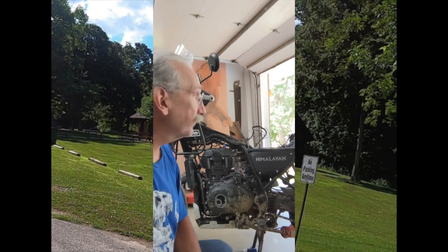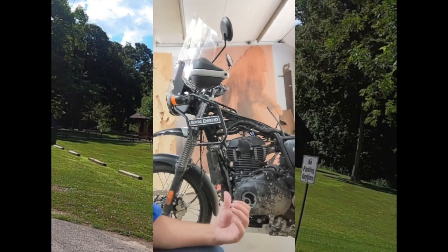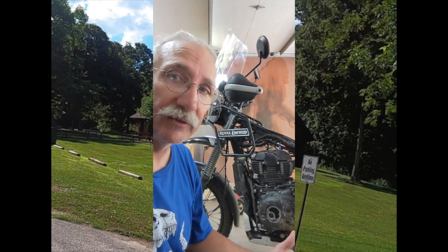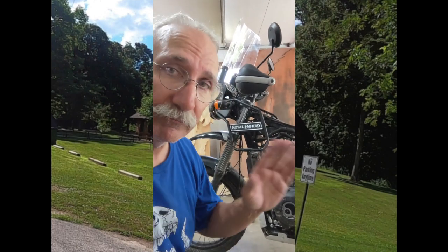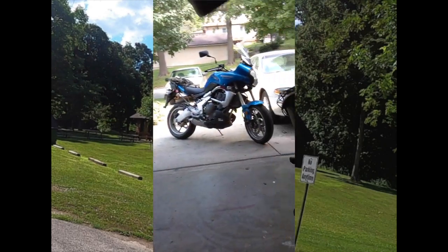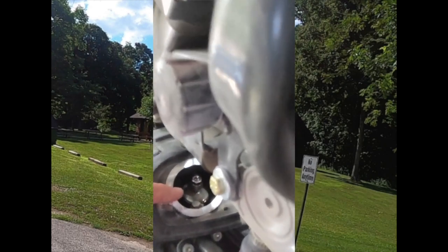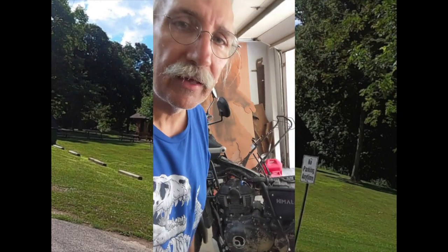Fuzzy Biker here — we were in the Fuzzy Biker garage doing a little motorcycle work. The Royal Enfield Himalayan right there. I just checked the valves — I was going to adjust them, but didn't need to. Just like I left them 5,000 or 6,000 miles ago, so no need to do anything at 12,000 miles. The valves are dead on — every time I pop this thing open they've been within spec. You can see the exhaust valve right there — it's got one exhaust valve and one intake valve. I also did a little work on the vent system for the gas tank. Every now and then my gas tank would pop open and just make a big noise.